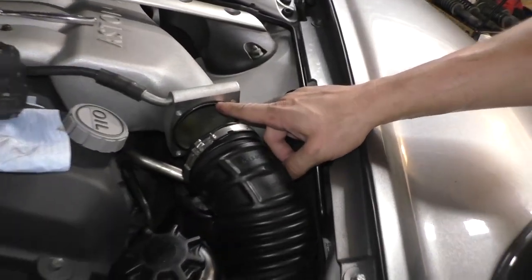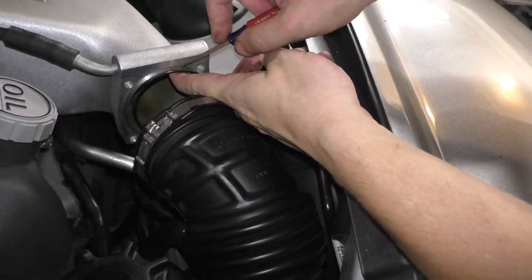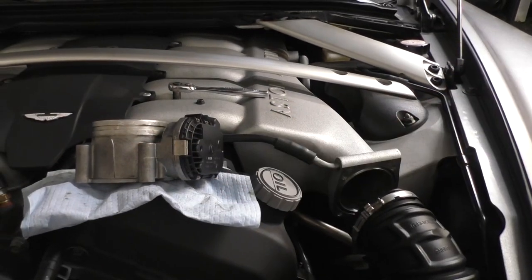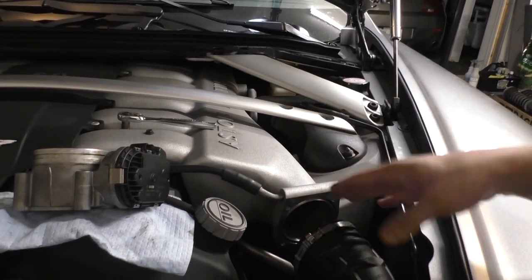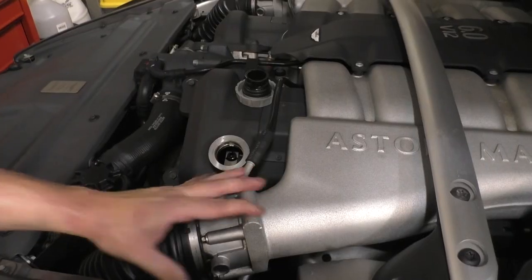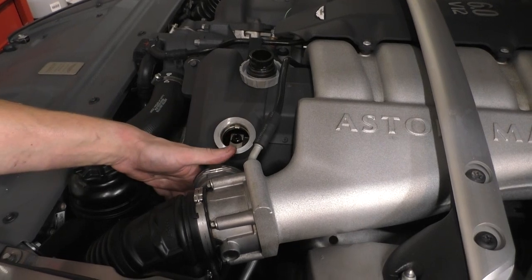Now that we've put the filter back in place, we can reassemble everything. We're going to replace the O-ring — you can use a pick or your fingernail, or that flat head screwdriver to pop it out. All I had to do was poke it to pop it out. We're going to replace that and put the throttle body back in place with the four bolts. I didn't actually disconnect the throttle body wiring connector, so I don't have to worry about that — I just set it out of the way, using a paper towel so nothing gets scratched or dirty. Once we put that on, we can reconnect the hose that I had pointed out and then refill. It is now reassembled and that hose down here is reconnected.